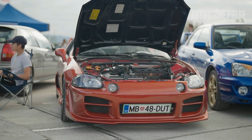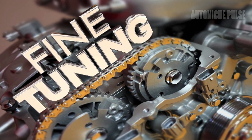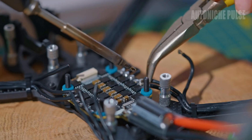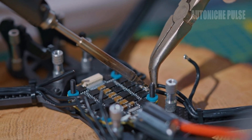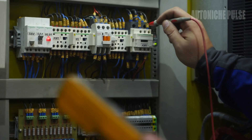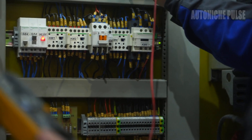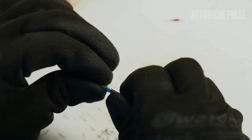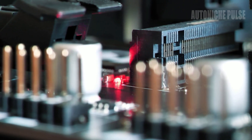Reprogramming or reflashing the ECM is the most sophisticated way to bypass or trick an O2 sensor. This method involves altering the ECM's software to either ignore O2 sensor data or set a fixed fuel mixture that doesn't rely on sensor feedback. This approach is often part of a larger performance tuning effort, where enthusiasts aim to optimize their engine for power or efficiency beyond what the manufacturer intended. It requires specialized tuning software and hardware, and typically professional assistance or deep technical knowledge, as incorrectly modifying the ECM can lead to engine damage or failure. The software can adjust parameters so the ECM doesn't throw a check engine light, or can be set to run at a constant air-fuel ratio to enhance performance in modified engines.